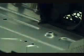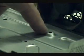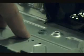Now we're going to see this little support here on the back of the board, and then there's another one right here in the front. What we've got to do is grind those down to 3 millimeters. By the way, to know how high it is, you stack three washers right next to this and put them at eye level. Just make sure this is 3 millimeters. This is just above 3 millimeters, which causes some flexing problems in the board.